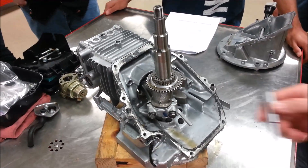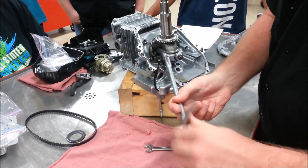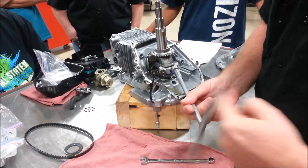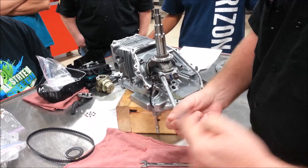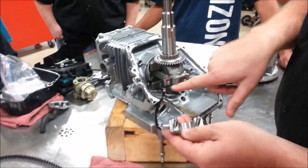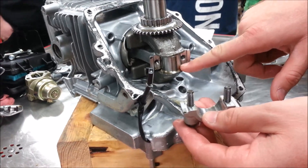I'm a huge fan of T-handles. I would not want to put any real fast spinning on that — I wouldn't want to use power tools and spin this around because I would score the crankshaft and the journal surfaces. This is a journal, so we call it a crank journal. This is also considered a rod journal to be more specific.